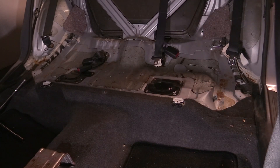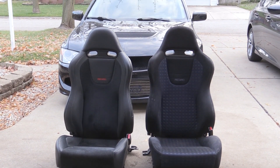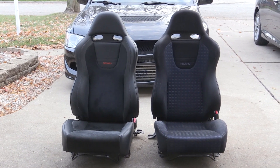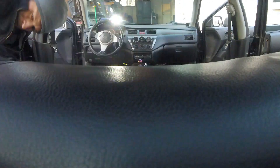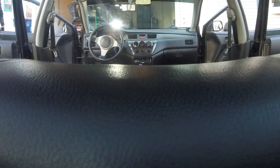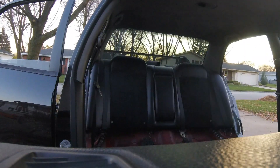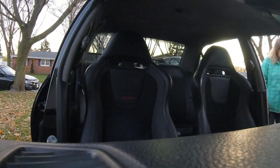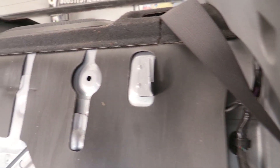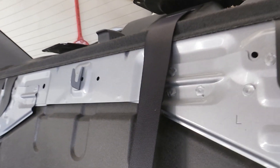Reinstalling is obviously just the reverse process. A key tip for reinstalling this upper portion of the back seat: have the seat lifted up, then put some force into it and push it back towards the rear of the car while you push down. You should be able to get it onto all three hooks. You'll know if it's hooked in because if you grab the seat by the top and try to pull it forward and it just flexes forward easily, that means you didn't get it into those hooks. Here I'm showing you exactly what those hooks look like.